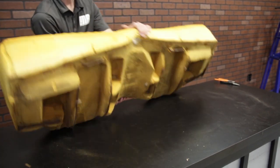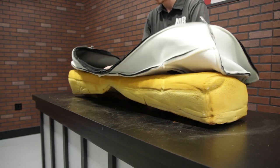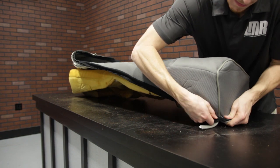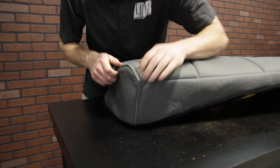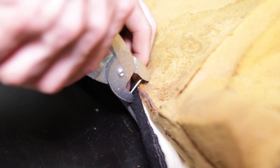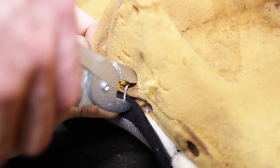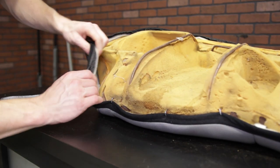Position the seat bottom right side up. Turn the bottom upholstery inside out and then align the Corbeau rear seat upholstery with the seat foam. Now roll the upholstery over the bolsters. As you roll it over, be sure and pull tight to smooth out the wrinkles. Flip the assembly over and prepare a hog ring into the pliers. Pull the upholstery tight and secure the black material on the upholstery to the listing rod on the seat foam. Start in the center and work your way down the back of the seat.